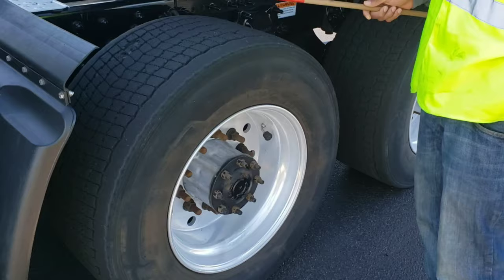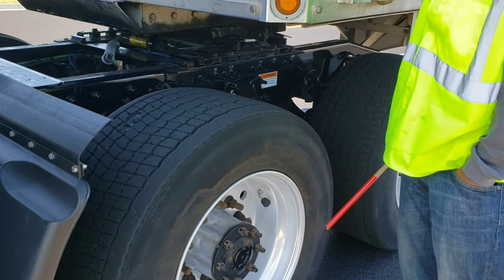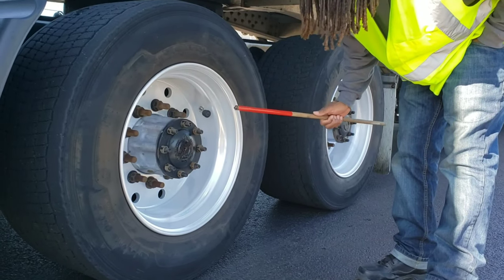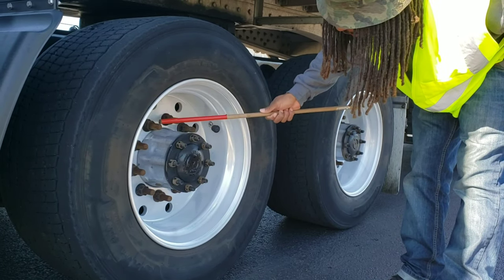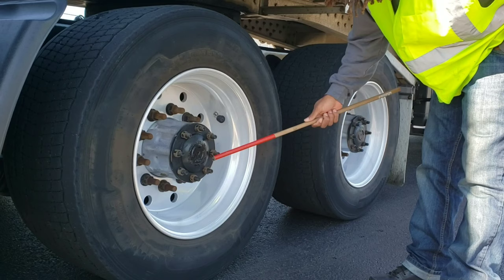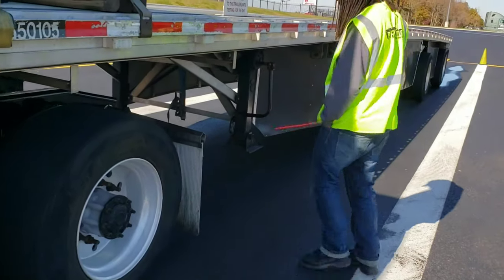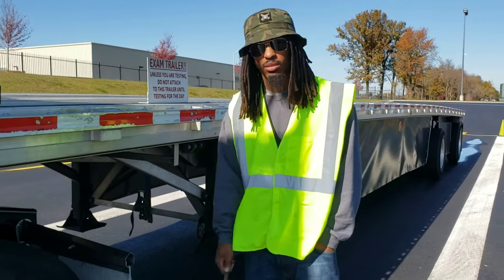My tire is properly mounted and secured. On the tread and sidewalls, no abrasions, bulges, or cuts. The tread is no less than 2/32nds of an inch, and it's filled to manufacturer specifications when checked with an air gauge. My rim is properly mounted and secured, not cracked, bent, or broken, free from any unauthorized welds or holes. My lug nuts are properly mounted and secured, not cracked, bent, or broken, none are missing, no powder residue or rust trails, and no cracks around the bolt holes. My axle seal is properly mounted and secured, not cracked, bent, or broken, it's not leaking, filled to manufacturer specifications, and there are no missing mounting bolts. My mud flap is properly mounted and secured, not cracked, bent, or broken. That wraps up the driver door fuel area.